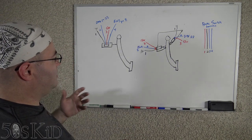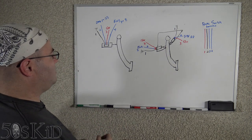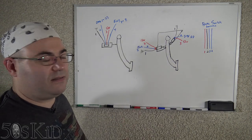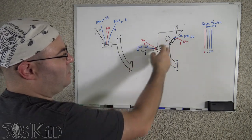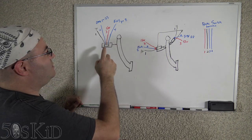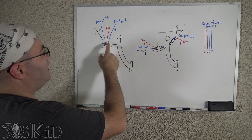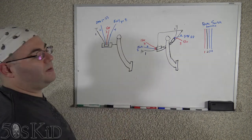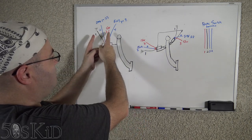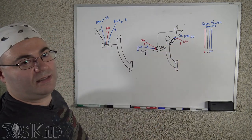The new style is a little different in that it doesn't have two individual three-wire clutch switches — it just has one four-wire clutch switch. Pin number one is the ground, pin number three is the 12-volt. You run those over to the brake switch harness in exactly the same way. The only difference is you don't have two wires — you only have one, because you only have one switch. Pin two runs up to the DME on pin 23, and pin four runs up to the EWS on pin eight. The wiring is exactly the same; the only difference is one power and one ground versus two powers and two grounds.